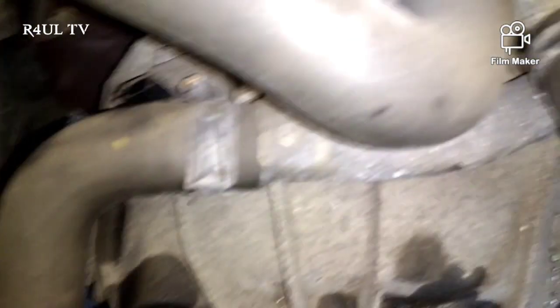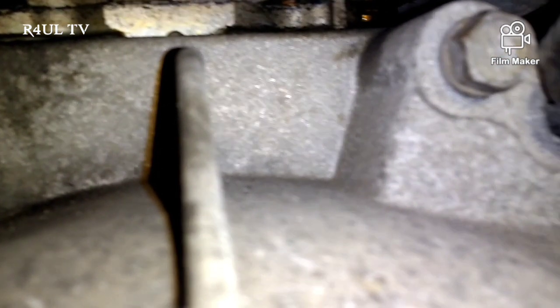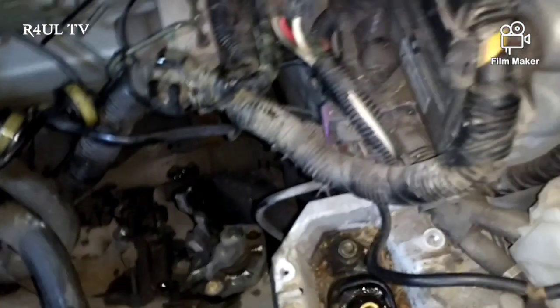After that we're going to take the bell housing bolts off - two of them on the top. As you can see there's one there and another one on that side. There's also the starter bolt which I've already taken off - that's a 14mm. The bell housing bolts are 14mm as well. Just make sure you don't get them mixed up - put them separate, because you don't want to crack the engine block.